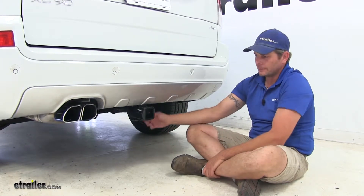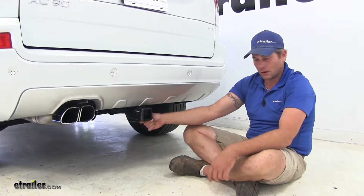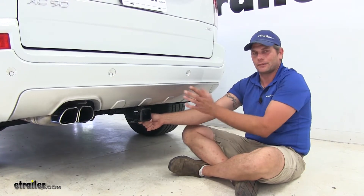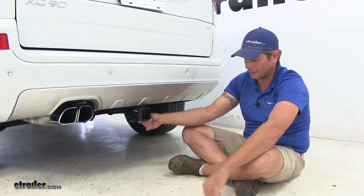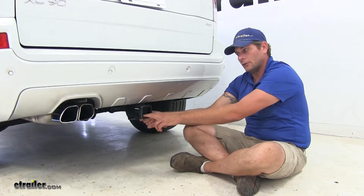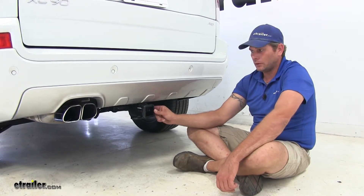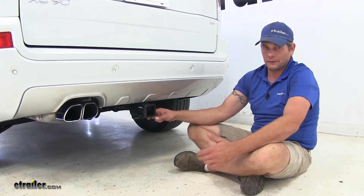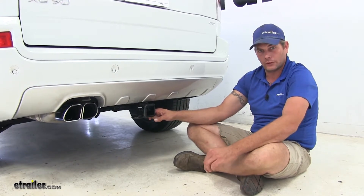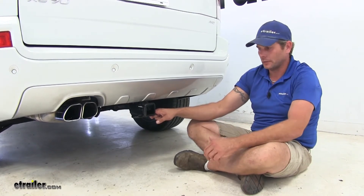For recreational usages — bike racks, cargo carriers, or any other Class 3 type accessory — I think the Draw-Tite is going to be the better option because it has that higher tongue weight rating, which is going to eliminate some of the flex. Although if you are using a cargo carrier or a bike rack with a very short shank, that inch and three-quarters that the pin hole moves back will be a slight advantage for the Curt, but only in that situation. With your four-bike racks, five-bike racks, or bigger cargo carriers, the Draw-Tite is definitely going to be the way to go.